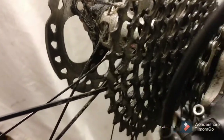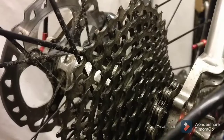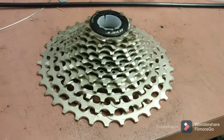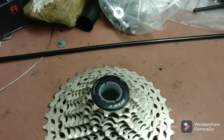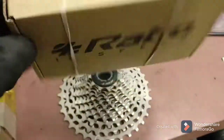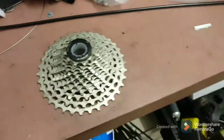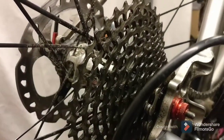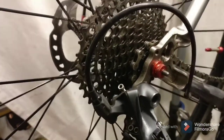I'm going to try something and hopefully it works out. Just in the process of stripping down the bike, ready to clean. This is my current 11-speed rear cassette and I'm going to convert it to a 12-speed. This is with the Ratio Technologies 12-speed adapter. So what I'm going to do is start stripping this down and first see if this cassette will fit in this aperture with what gap I have or haven't got.